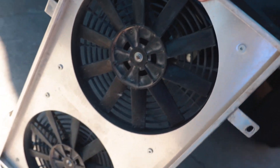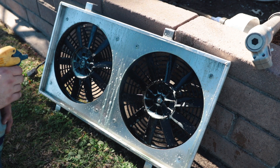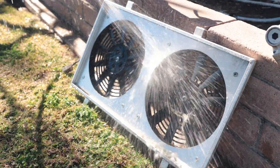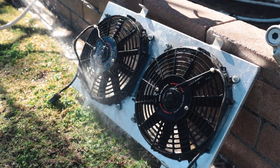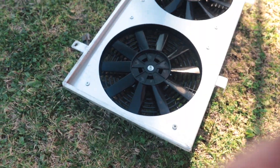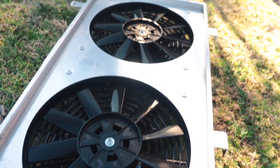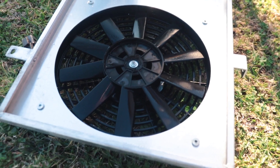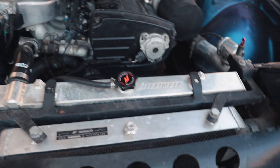I have the fans out and I want to clean things up a bit — there's some buildup and dirt everywhere. If you're going to wash your fans or anything electrical, make sure you wait for it to fully dry before hooking it up to power. As long as it's fully dry it's not going to get messed up, but if it's still wet when you reconnect power you risk damaging something and hurting your wallet.